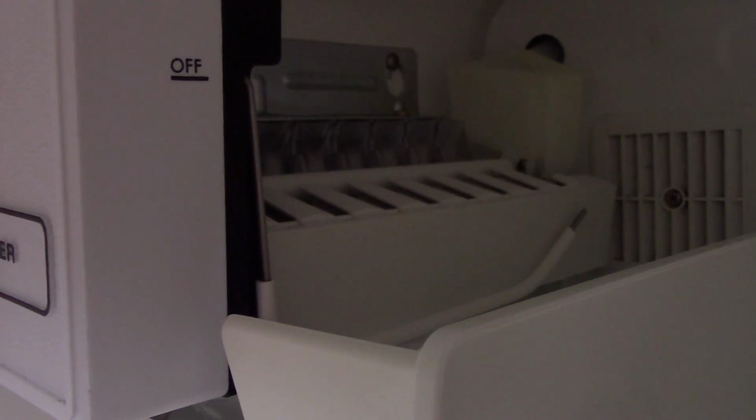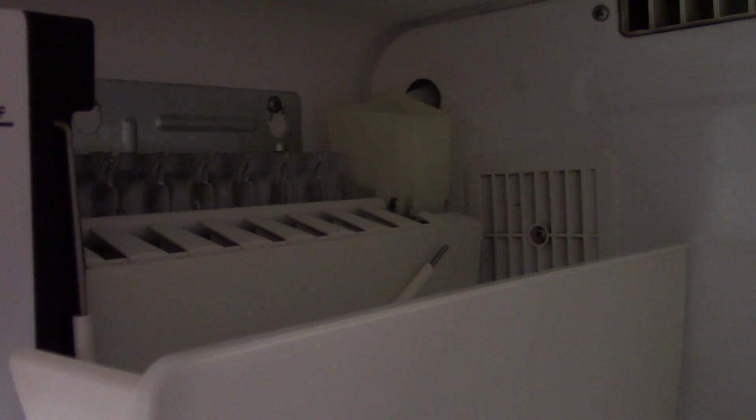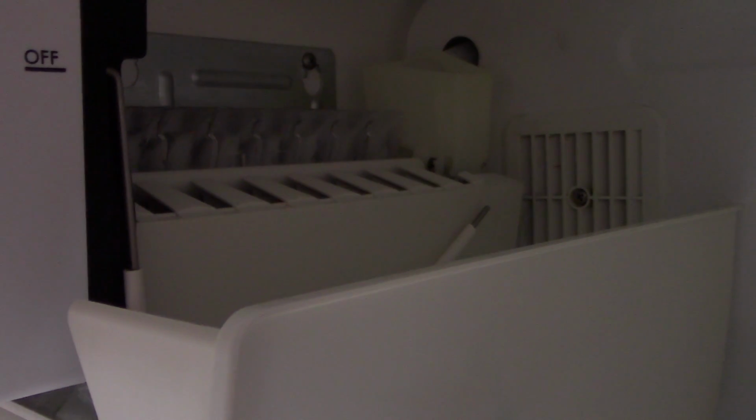And then we got a little random frost going there. Defrost circuit's working, but something's just going on. I don't know. I'm kind of leaning toward a restriction in the refrigerant circuit, but this will be part one, and we will see what takes its place here in a little while. But I guess we can capture a final ice dump. I'll probably save this ice maker and accessories.